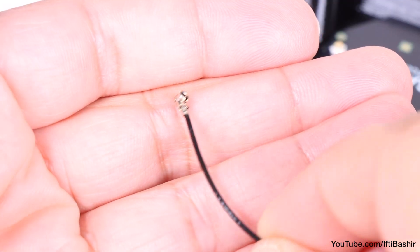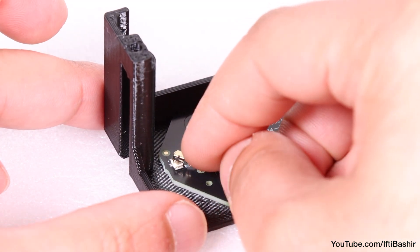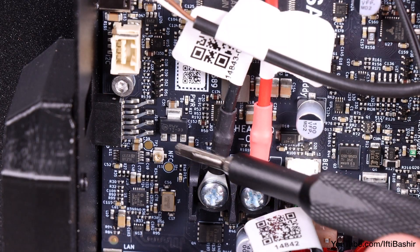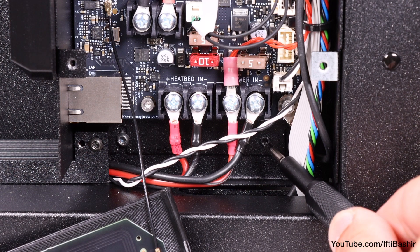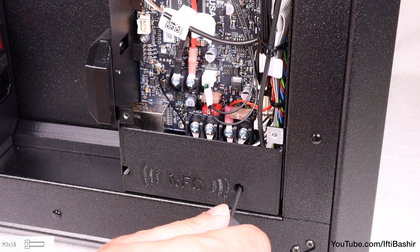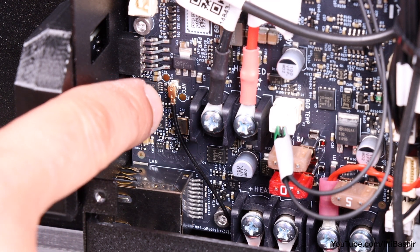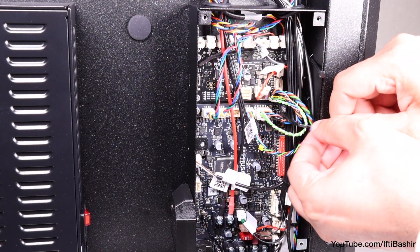Install the cable to the tiny connector by applying even pressure until you hear a click — take care not to misalign or use excessive pressure as you could cause irreversible damage. Repeat with the opposite end, which connects to the tiny port labeled 'NFC' just beside the heat bed power cables. Ensure the two threaded holes are not obstructed by any cables so the cover can slide into place, then secure with two M3x10 screws until snug. Check that the NFC cable passes in the gap between the heat bed power cables and the ethernet port so it's not damaged when the electronics board is covered.